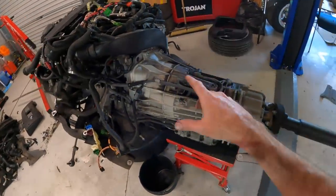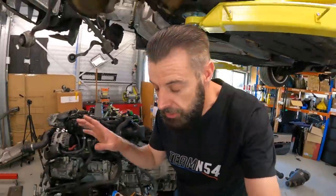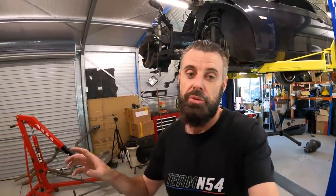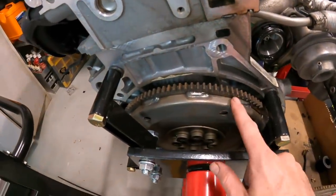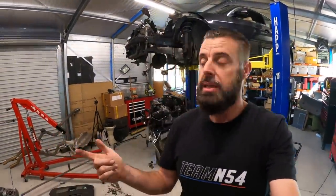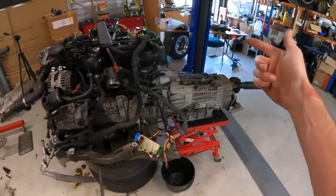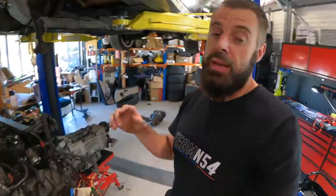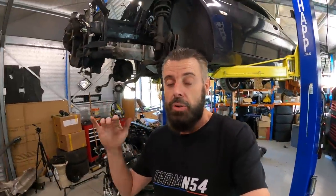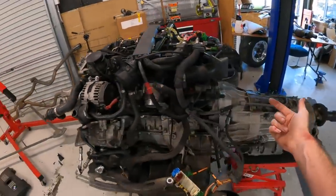The other tricky thing on the hardware side is the way the transmission connects to the engine. All the early N54s have an eight-bolt crank. You can see there are eight bolts that hold the flywheel onto the crank. The DCT has a very different flywheel to the manual and 6AT cars, so if you bought a donor car, you need to make sure the flywheel will bolt onto your motor. My motor is a late 07 car so it has an eight-bolt flywheel, while the donor is an early 09 car with the newer six-bolt flywheel.